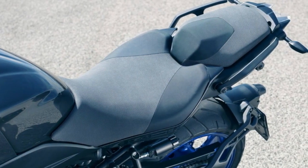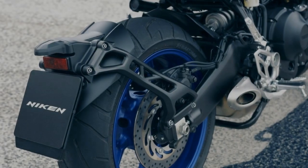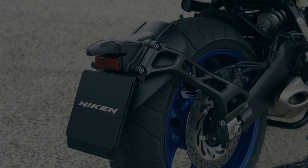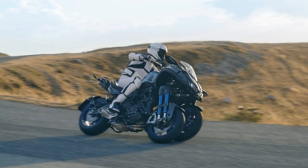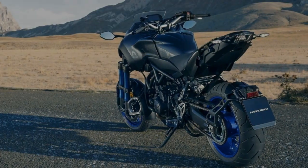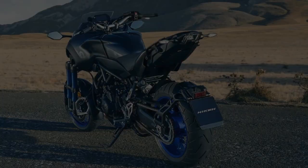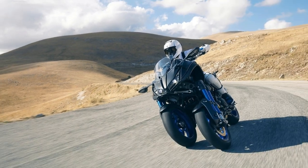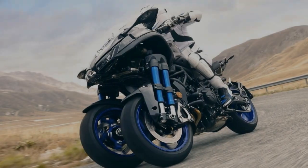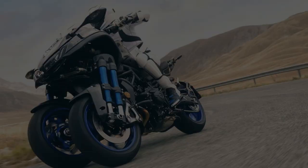For all I know, that's what the engineers had to do in order to overcome that inherent stability enough that it didn't turn into a wrestling match at every turn. Yamaha pushes the Niken with this 847cc CP3 powerplant. The water-cooled inline three cranks out something around 115 ponies at the shaft at 10,000 rpm, with 65 pound-feet of torque at 8,500 rpm. Decidedly over-square, the bore and stroke measure out at 78mm and 59.1mm respectively, with a ceramic cylinder treatment meant to resist wear. Dual overhead cams time the four valves in each combustion chamber, and the YCCT fuel injection works with three dissimilar-length intake tracks for a wider torque band without going to the trouble of building a variable-length intake.